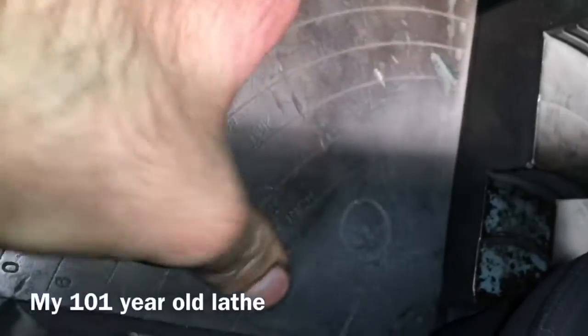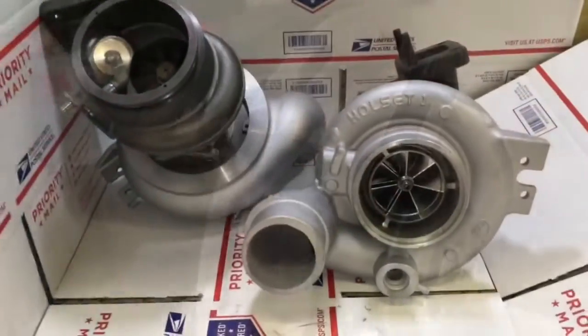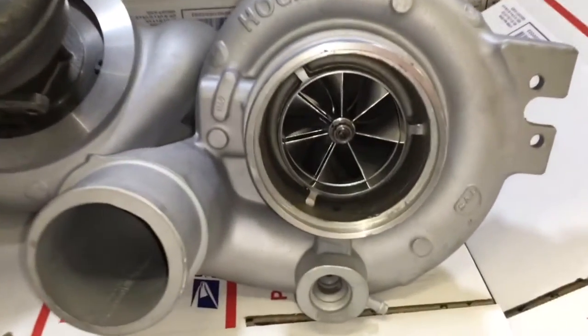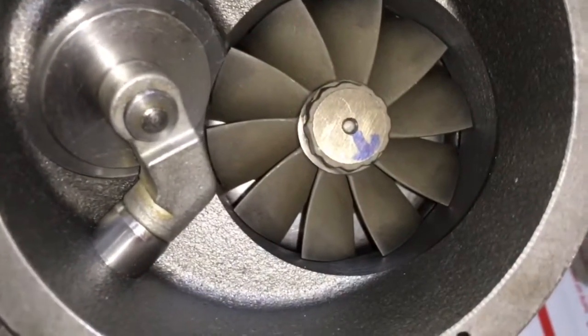If you decide to just buy our turbine wheel, be sure to machine your turbine housing out to 0.7 millimeter larger than your turbine wheel. Also, the distance between the radius of the turbine wheel to the turbine wheel itself when mounted is 20 thousandths. You can measure this distance using a dial indicator and the original heat shield, knowing that there's 50 thousandths between the heat shield and the turbine wheel — pull the dial indicator from the turbine housing to the indicator and you'll come out with 70 thousandths.